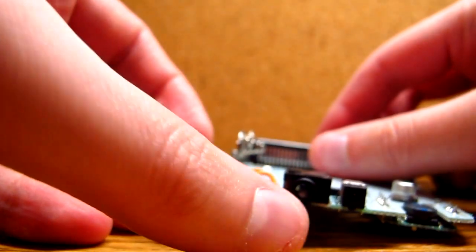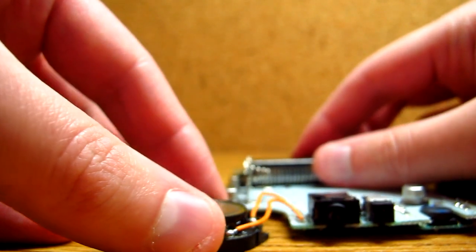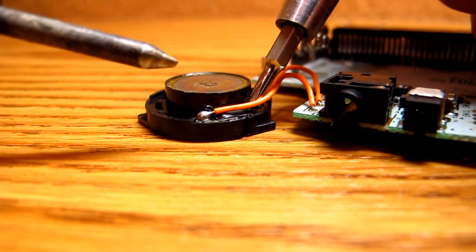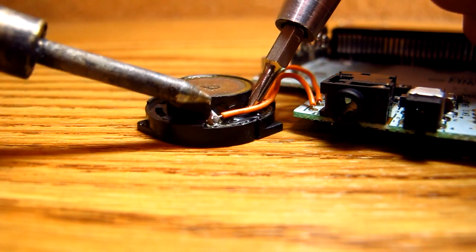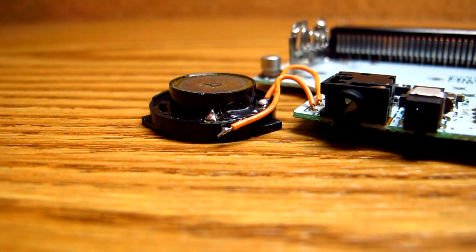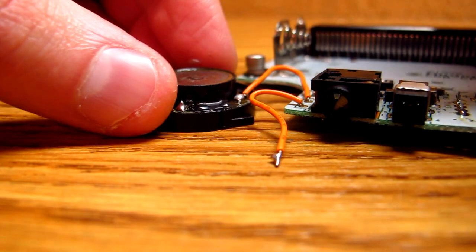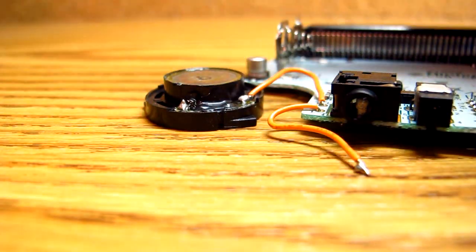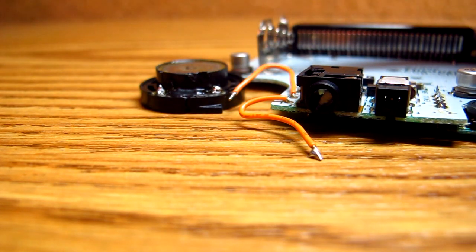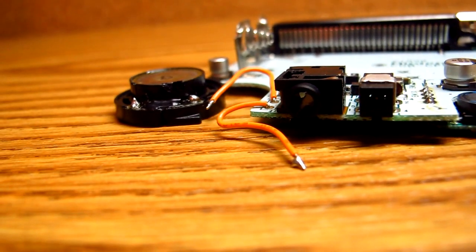What I'm going to do here is fold out the speaker just a little bit, and I should get a better camera angle for this. There we go, everything seems neatly in focus now. Now I shall take my soldering iron and something that is not my hand, heat this area up till it gets all molten — and there we go, it will separate nice and neatly. I'm going to put the soldering iron back in its holster while I get the other one in position. No flux even necessary to heat that sucker up. As you can see on the wires, there's still a decent amount of solder on them.